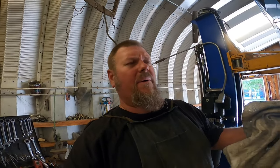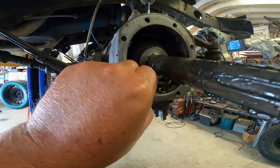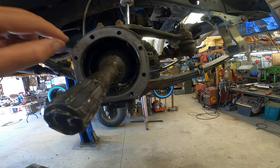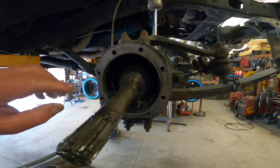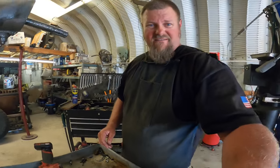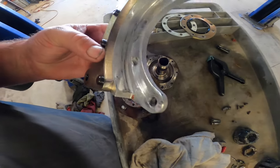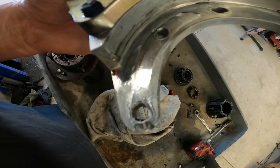All right, so I got that thing cleaned up. Now I gotta get in here and get a stud pulled out - or what's left of a bolt, I should say. Go through, clean all these threads, tap them - or I should say clean them out - make sure those are all good, and then start to figure out exactly how to put this thing back together, clean it all out and do it with loctite because this can't happen again.